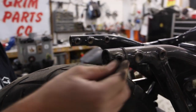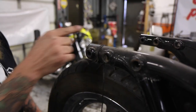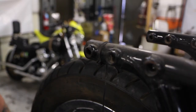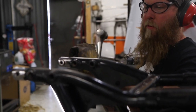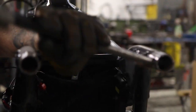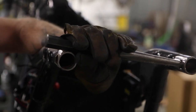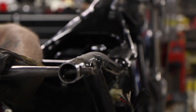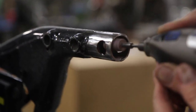What we're going to be doing is removing the stock bungs that are welded in here on the frame. This part is a little time consuming. You want to be careful to just kind of grind the weld, then we'll knock the bungs out and get ready to install the new strut eliminator kit. With your punch, just kind of work them back and forth — this one's come loose, pop her out. If it doesn't want to move, you don't want to wail on it so you don't deform the tubing. Just keep grinding and working at it. To save yourself a little headache, take a Dremel and clean up the inside of the frame a little bit because we're going to be slipping stuff in here.